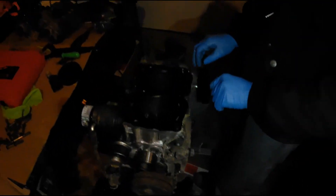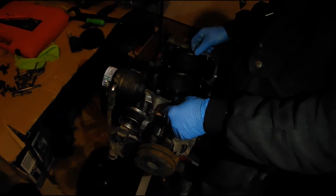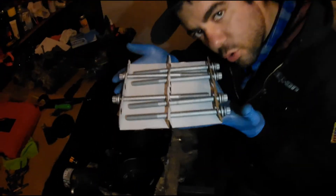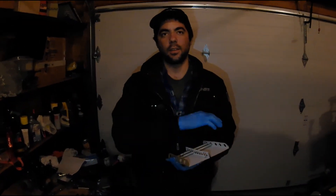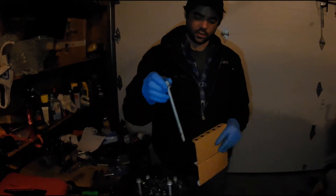This is the redesigned head gasket — it's two-ply instead of the OEM paper ones, so these will definitely hold up a lot better. We're not going with ARP head studs; we're using OEM stretch bolts, which is completely fine because this is going to be just a naturally aspirated daily driver. We are finally putting head gaskets on this motor. If you own an older Subaru, you should definitely get this done every 100,000 miles.